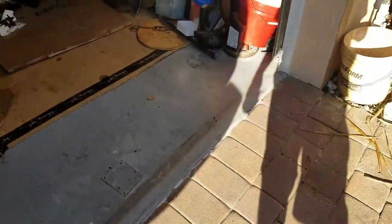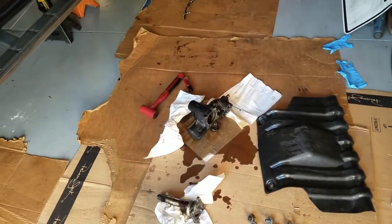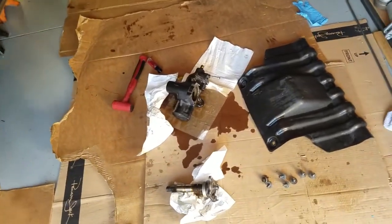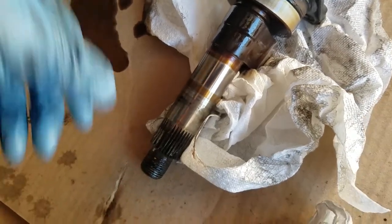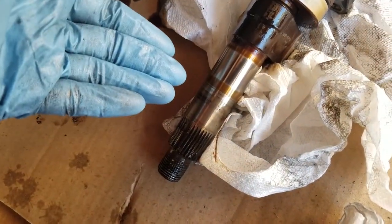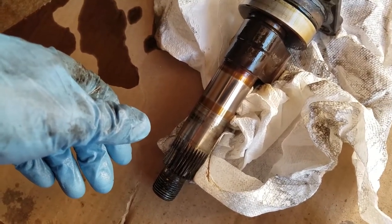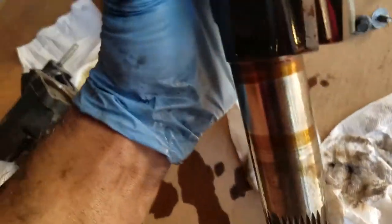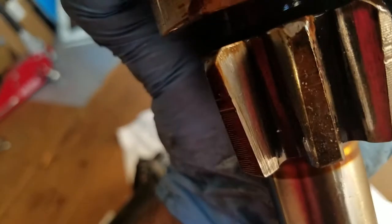This thing's ruined too. I don't know how many times I did this, but the steering box is now apart — it's pissing out the Pitman arm seal. I also noticed it's super loose because the gears are worn on it. So I don't even know if this part is serviceable. But this thing needs a new rack, and it's pretty damn worn with the teeth on it. There's a lot of play in it side to side.